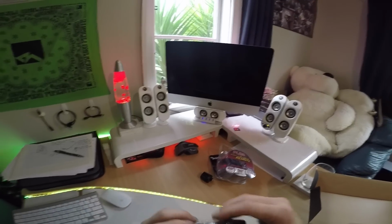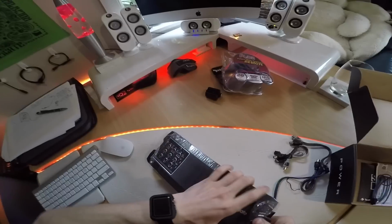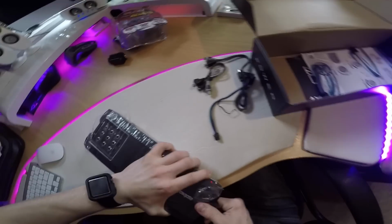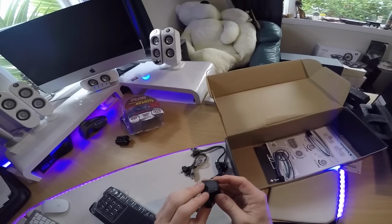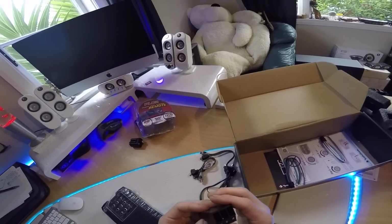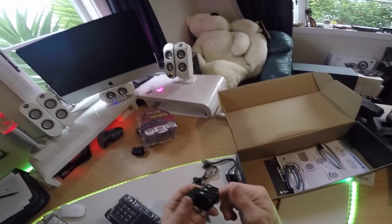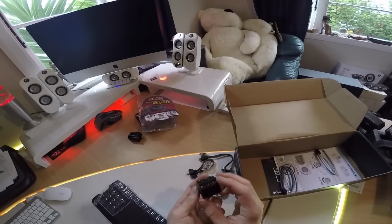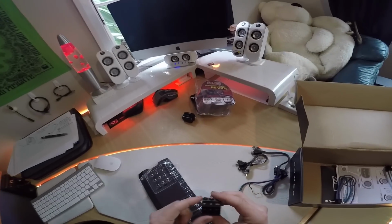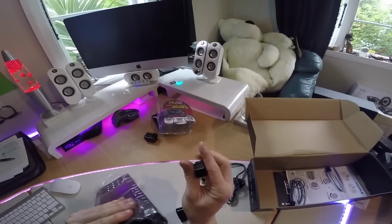And then at this end we've got our connectors. So this is the big power connector, which these are cool because they do just unplug. They're pretty stiff, which is a good thing, you want that. But they do just, there we go, unplug. Supposedly, like it says on the website, you can fit 4 gauge in here. I have tried fitting a couple bits of 4 gauge in here and it's very tricky. I guess you could fit some cheap 4 gauge in this, but not like some really high quality stuff, which is mostly copper. So either some really high quality 8 gauge or some cheap 4 gauge will fit in these terminals. And then you've got another one which unplugs for your subwoofer channel that looks like 12 gauge sort of ports.